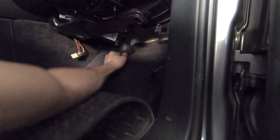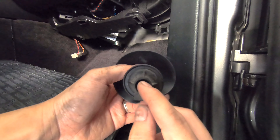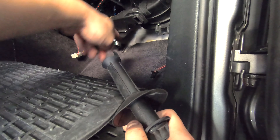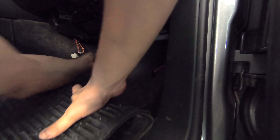While you're in the passenger side footwell, take care of the AC EVAP drain. Grab this rubber piece over here and pull it off. Mine has already been modified — there's normally a rubber flap on the end that can get clogged over time. Just grab the rubber flap, rip it off, and then reinstall your drain port. Make sure it's seated 100% flush against the firewall and making a tight seal, or else you can get water into your cabin.